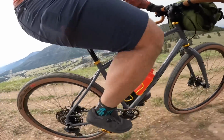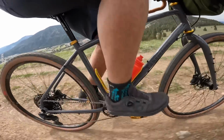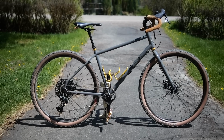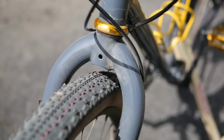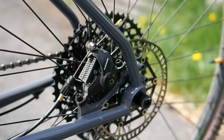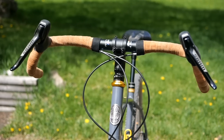The Hardtack is a bike by the bike brand Tanglefoot, which is the house brand of Analog Cycles, that bike shop in Vermont that was once housed in a yurt, but they've since then moved. And it's meant to be the slimmed down version of their Moonshiner, which is their version of a drop bar mountain bike. Biggest differences are that it has a unicrown fork. It doesn't have that biplane fork construction. The fork is also significantly lighter, and it also doesn't use boost spacing. In many ways, it is the svelter, lighter, more supple version of the Moonshiner.